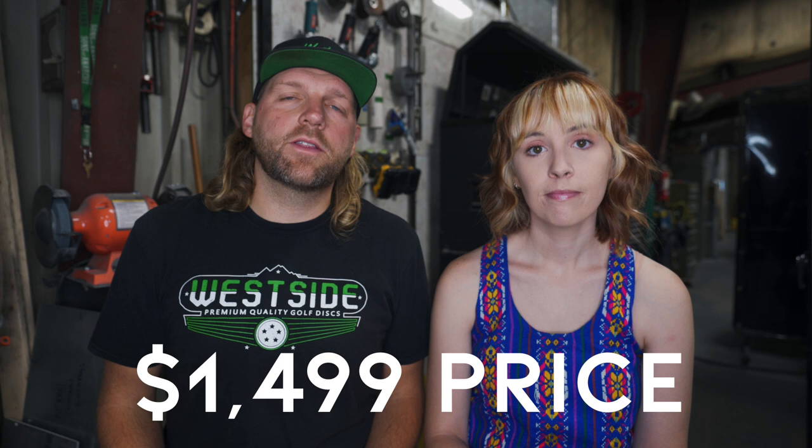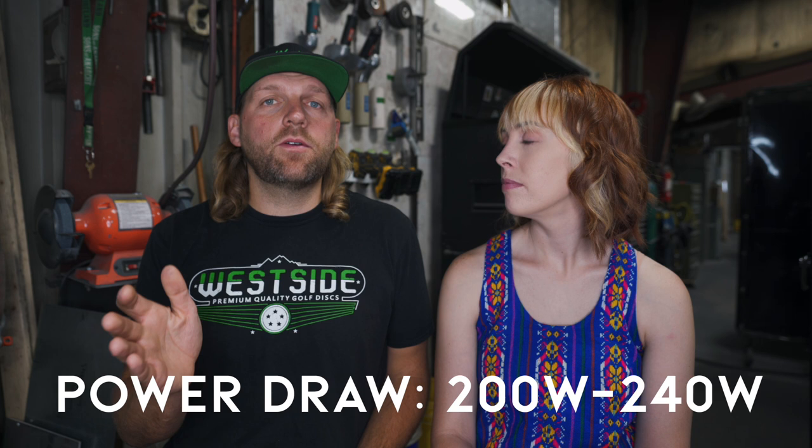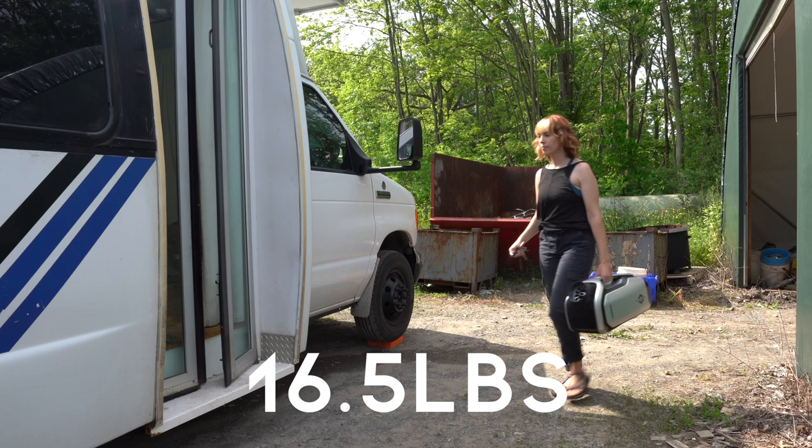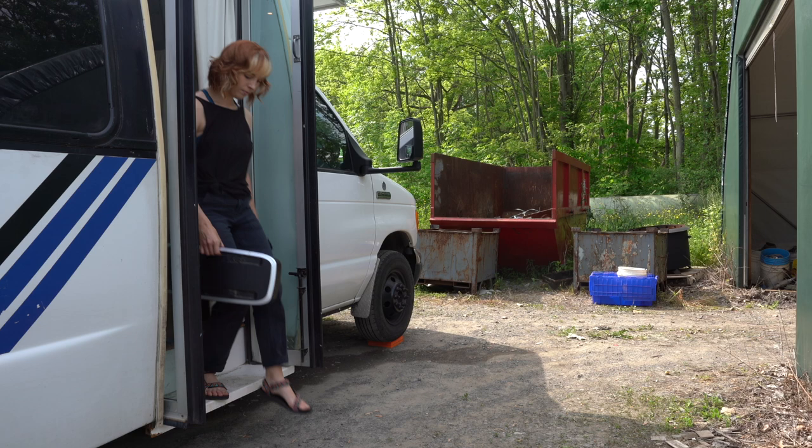As far as the power draw, we find that it runs between 200 to 240 watts on high. If it's really hot it'll boost up to that full max of about 240, and if it's a little cooler it might cycle down to around 200. Either way, for a cooling unit that's incredibly low. The unit weighs 16.5 pounds, and adding the battery on the bottom adds some additional weight. So while it's too heavy to carry around day to day, it's pretty light for what it is — a whole battery-powered air conditioning unit.